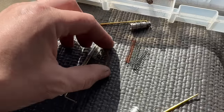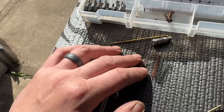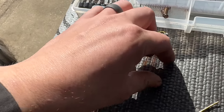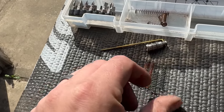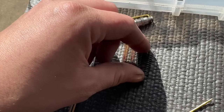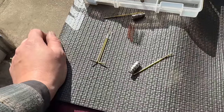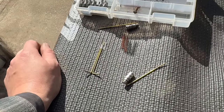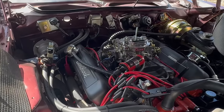But with that in mind, the stiff step-up springs make sense. These are the orange, which are actually a middle-of-the-road unit. I'm going to go for these. I think these are actually blue. Not that they really look blue. They feel a good bit weaker. We'll see if that gives us the result we want. And I'm just going to go ahead and do an experimental needle change at the same time. If it doesn't work out the way I want, again, it's really easy to change.